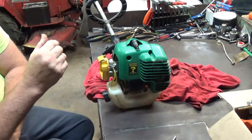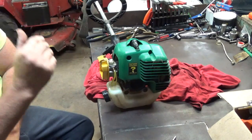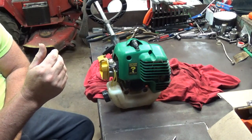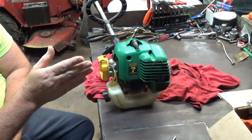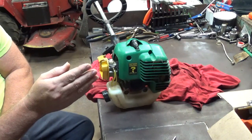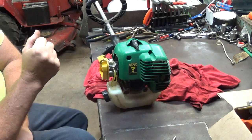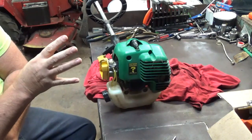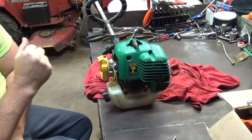So be careful when you're adjusting carburetors, especially on limited coils that are up in the 13,000 RPM range, because you can actually lean it to a point where you think you've got it, but it's actually the coil causing it to 4-stroke, and then you've got it so lean that you burn stuff up. But this is just basic settings. This is how to do a basic setup to get you into the ballpark.